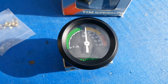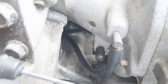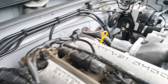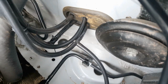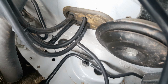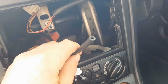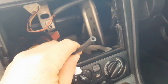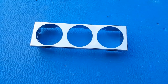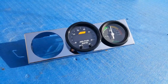In order to get this thing installed there are a few things I need to do. Firstly, I need to get a vacuum line from the intake manifold of the engine to the gauge, which if you saw last episode you kind of know I've already done. Because in that episode, when I was running the vacuum line for the mini bypass valve, I teed into it right by the bulkhead and then ran a line into the cabin through my favourite grommet — I run everything through this grommet. That was pushed through into the passenger compartment and I've basically fed it up the back of the dash ready for when I fit the gauge. If you've followed this series for a while, you'll know where it's going — in the MX-5 parts panel I bought and installed way back in episode five.